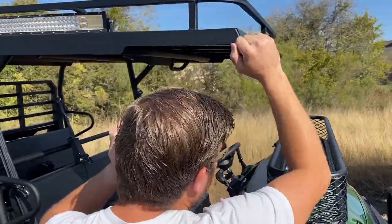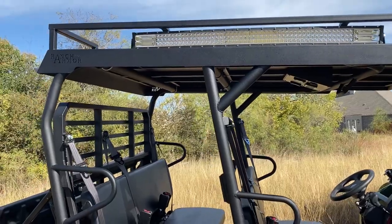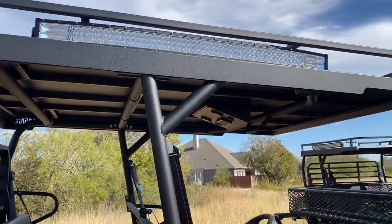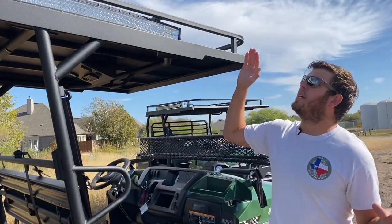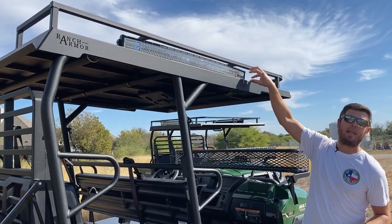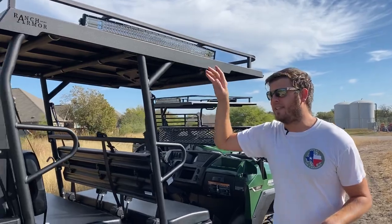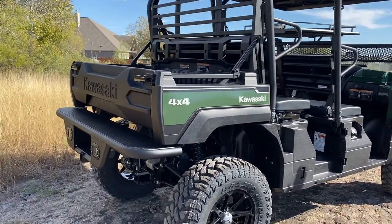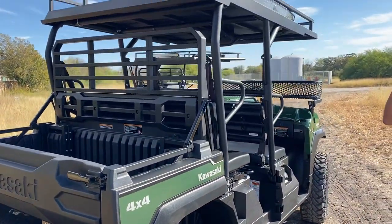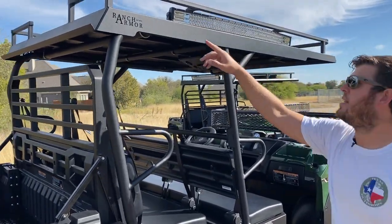As far as the roofs go, there's no front light on the roof — he didn't want one. He just wanted a light in the bumper because he wanted it to project from a lower point, not the upper point. On the sides we did something a little unique — he wanted more of an optical light, so we did 40-inch curved tri-row lights with high-focus beams on the outside. His rear lights also come from the bumpers — kind of different, because most of the time people want lights all the way around up top, but this customer really wanted the lights on the bumpers and the side lights projecting from the top.